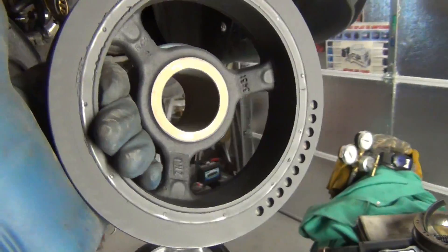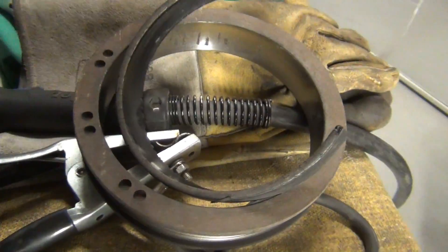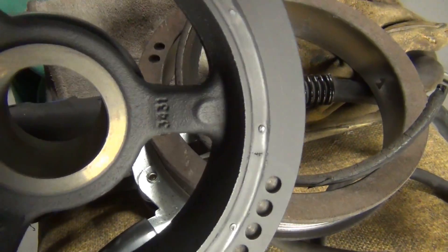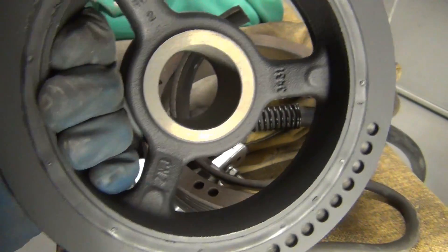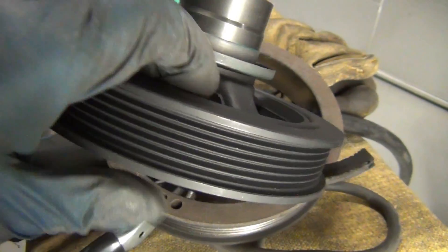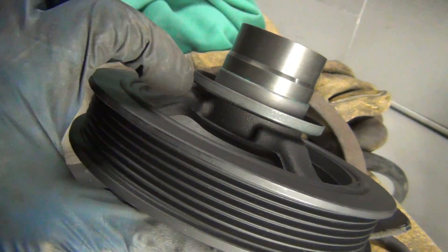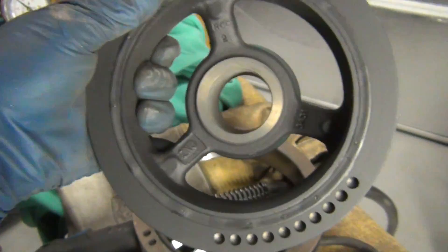It's really hard to find a harmonic balancer for it. This is the old harmonic balancer and the rubber that used to hold the ring on. You can see where it is here. But there's no bolt holes to get this out - it's stamped for them and they're really wide. But if you look on the back side of this thing, it's got little notches cut into it where you can use a three-jaw puller. From this side you don't notice that.